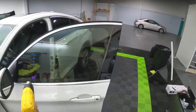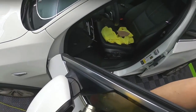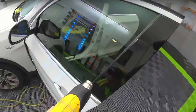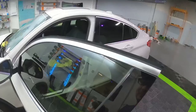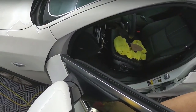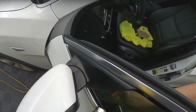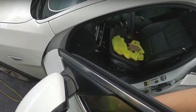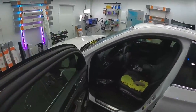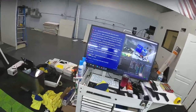Just tape all the things now. Tape the sides, tape the bottom. Scrub everything down, clay bar — either or. I'm getting pretty similar results with the scrub pad and the clay bar. But there's some things the clay bar is really good at — cleaning laminated windows, because it gets that laminated edge really well. Would contaminants be the reason sometimes squeezing the top edge gives little white spots that don't lay down? That's exactly the reason.